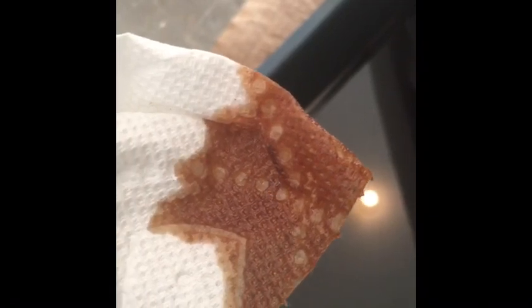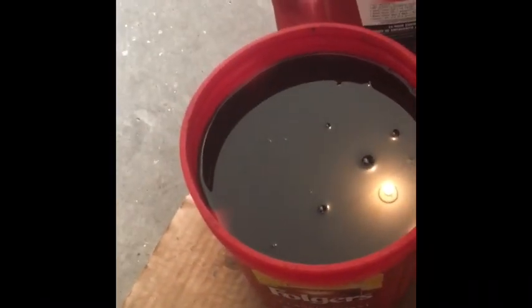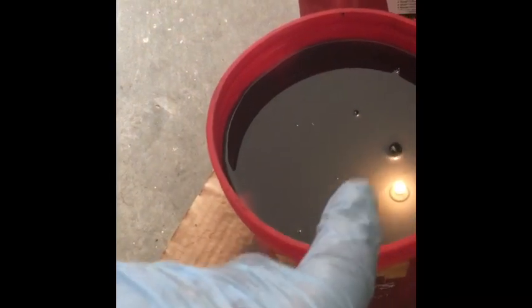So if I wanted to do a full flush, what you do is drain it 3 times with a few thousand miles in between each. This is a couple thousand miles since the last time I did a drain and fill. I don't know how much I got, I got cut off from a phone call. I just poured it into this larger Folgers container I keep just to put liquid in. This is about a gallon.